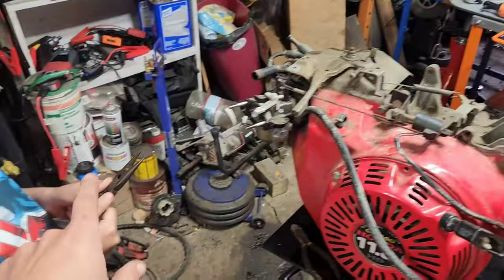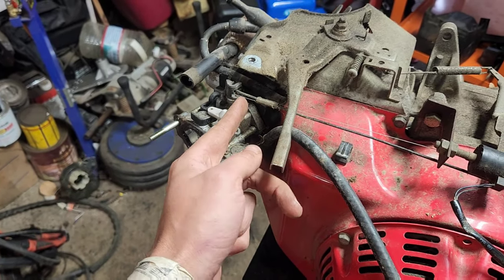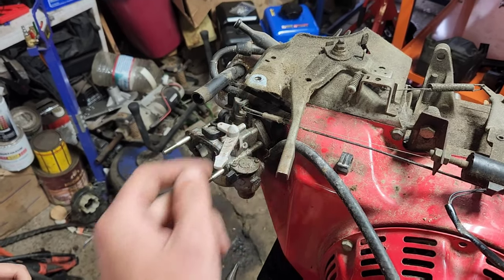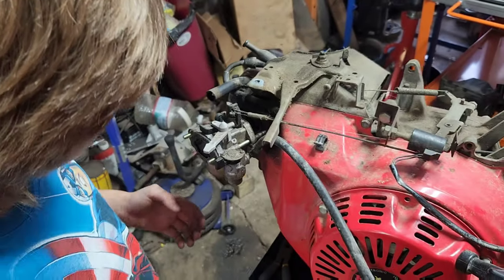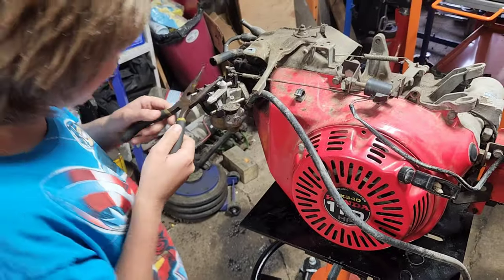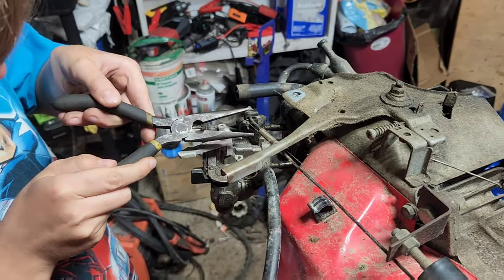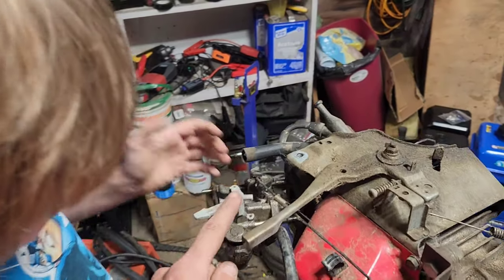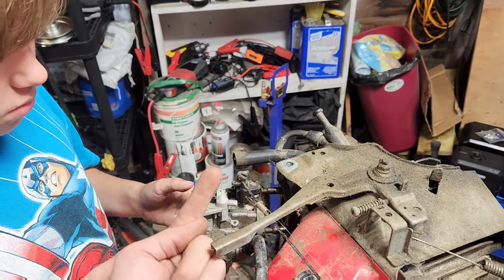You just needed to get more brutal about it. You got your needle nose pliers — what you're going to do is pull the whole carburetor a little bit, then loop out the spring, then continue pulling the carburetor out, and eventually this rod is going to lift straight up. You need to clip into the top section and then roll it up and out. As the carburetor comes off and this turns, eventually this rod lines up with that and it pops out.